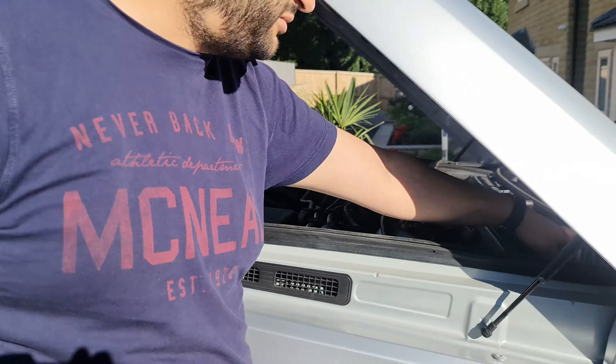Just try to lift it up — once it's up, that's perfect. That's the black cable out. Now the battery has two brackets — there's one bracket here and one there. Ours is a bit different because the previous owner just put a screw. Can you see the screw? Yeah, that screw needs removing. This is the original bracket, and to remove it we need a bolt — we're using the 10mm.